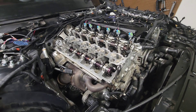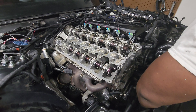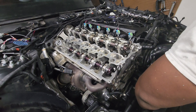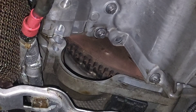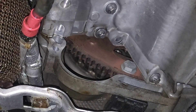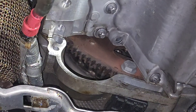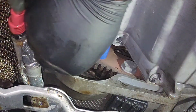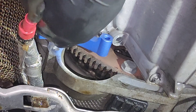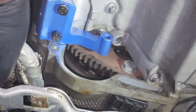We tried turning it again, and this is probably my first mistake — I locked the cams before trying to line up the crank. Jordan at RKTunes was really adamant that I lock the crank first. While I was turning it, I noticed that small turns of the crank pulley seem to have huge variation and a big swing on the flywheel end. You also only want to turn it clockwise. I did some counterclockwise turning to try to get the holes to line up, but that potentially added slack to the chain that over time threw my timing out of whack.